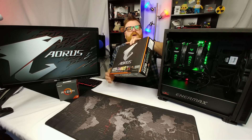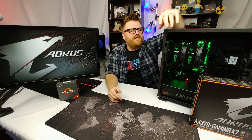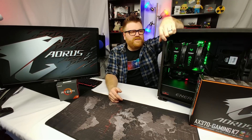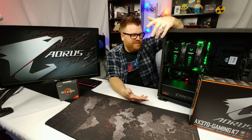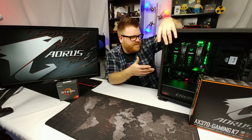This would be my favorite high-end one and I'm glad I bought it — I'll be sticking with it for a while. I know this wasn't exactly the heaviest review, but what I like to do is give my opinion based on actually using it. I've been using it for about a month and a half and couldn't be happier. Memory support is there — I tested every piece of memory I have and it always ran at the rated speed or above. I even had a Ryzen-branded kit rated at 3000 that would go to 3200 on this board.